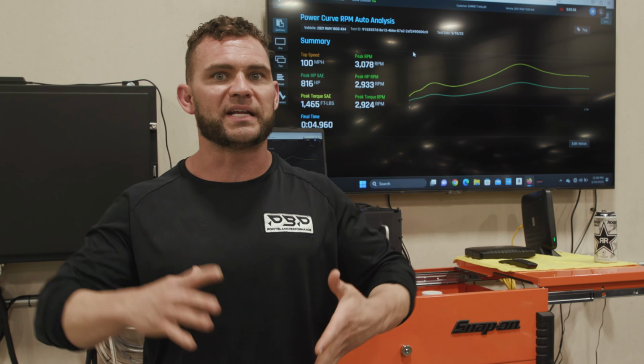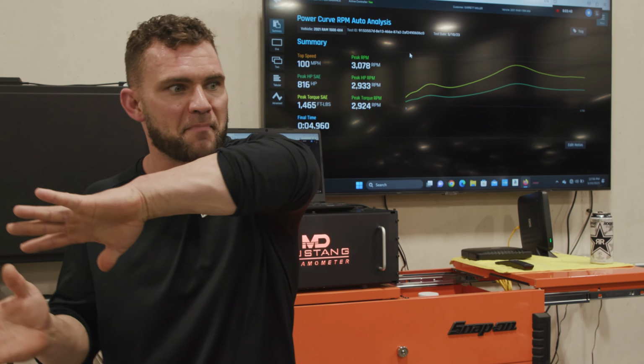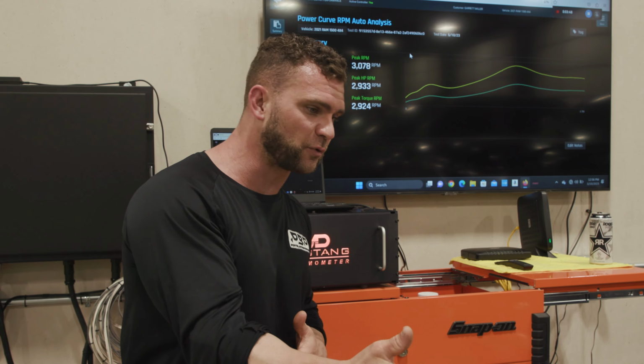We know it's hot, we know it's humid, we've got every excuse in the world, but here's what's logical. We added more fuel to the truck. We're working harder. Of course, the torque is gonna come up because we've got fuel to fire the flame. But we need the CFM of air to come into the engine and burn up that fuel to make the horsepower along the run, and that's just not happening. Long story short, for this Mustang Dyno on the S472 on that particular build, we are out of air, and we are not going to keep pushing, beating up the truck over 10 or 20 horsepower. This is exactly what it did.